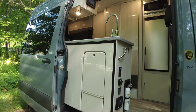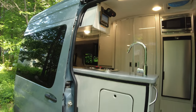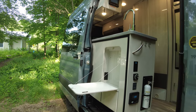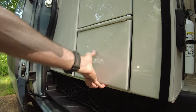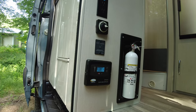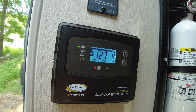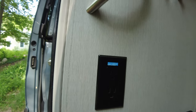Here's the outside of the kitchen unit. It's kind of nice that you can stand at the sink and look outside and kind of be outside while you're cooking. It's got a nice little fold-down table so you can have a workspace in the outdoors under the awning. And there are lots of little storage cubbies on here. Under the table is a little storage compartment — I'm not really sure what you'd put in there. On the left as you step in the door, there are some controls. This is the solar charge controller for the 175-watt solar panel on the roof. And then above it is on-off control for the 1,000-watt inverter, a master battery switch, and then an outlet.